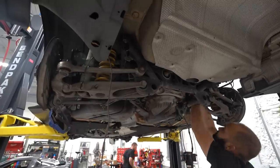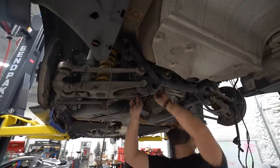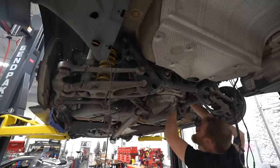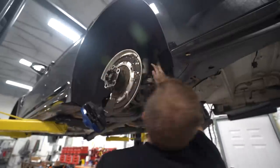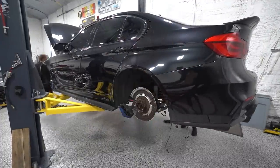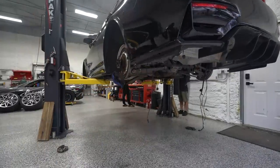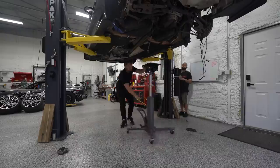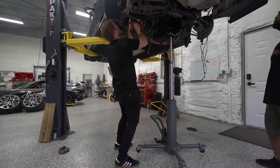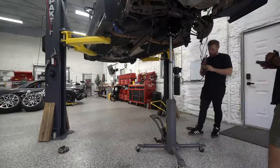With the car dropped down, we need to get the e-brake stuff out and start disconnecting everything so we can pull the subframe out. This car has an electronic locking differential, ABS sensors, and electric damping control, so there's a decent bit of wiring running through the subframe that we need to make sure we get unplugged, untangled, and out of the way so we don't rip it out on the way down. With that done we go ahead and unbolt the shocks, then I wanted to test whether we could get the subframe bolts out before we have it really close to the ground where it's hard to get a tool in there.